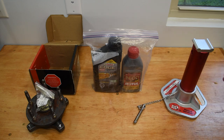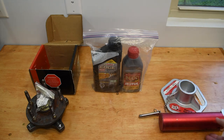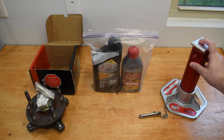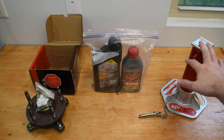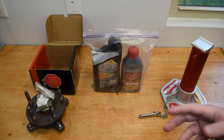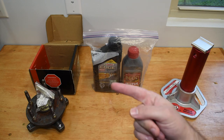On the far right we have a jack stand — an aluminum post-and-base style. I'll give credit to my friend John at NSXplore on Instagram, a pro-level NSX road trip aficionado, who turned me onto these. The key reason is they can be partially disassembled: pull the pin out and the post comes out of the base, so you can store the parts separately and tuck them into various nooks and crannies. When assembled, a little screw hole affixes it to the base, giving you a legitimate jack stand for changing a tire — much safer than relying solely on the notoriously unreliable scissor jack, especially on an uneven surface.